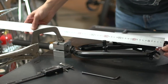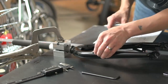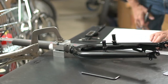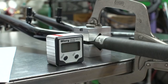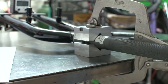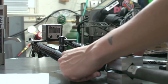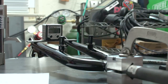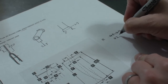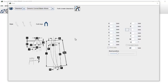I'm going around measuring all the other things on the fork. I printed out that page from BikeCAD and I'm just filling in the measurements I think are going to be needed. I actually realized I did not put the axle in plane with the table, so I'm doing that now and will re-measure my axle height. Keep in mind your rake is the offset of the axle from your steerer center — it's not the measurement from the table to the axle.